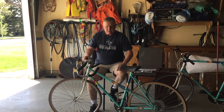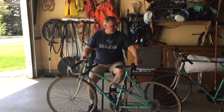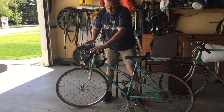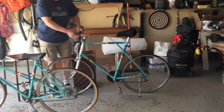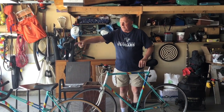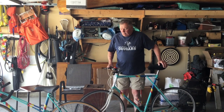And I have a pair of his and her bikes that I got years ago. And I'm changing them from a road bike to more of a mountain bike straight handlebar design. So this is the way the bike was, and this is what I want it to become. So I've already done one, and the reason I did this, put the straight handlebars on, is I find as you get older, I had to lean down much more on the curled handlebar design. So this helps my posture keep it more upright.